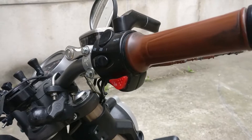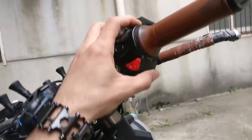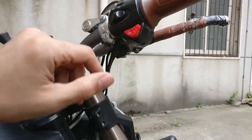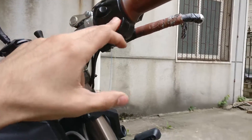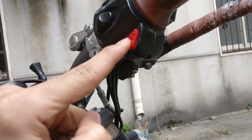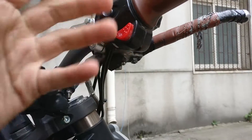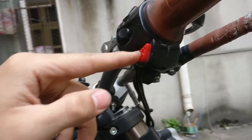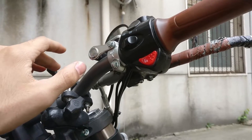I'm going to teach you two ways to fix it. One is temporary and one is to cancel it completely. Let's say you are somewhere outside home and you're watching this video and you just want to get back home without having to press the button all the time and using the throttle. It's pretty easy — just use any tape or zip ties and keep it pressured. It should get you home because it only works when the wires are connected; that's when the throttle actually gives power. It's better if you make it pushed inwards and upwards — that's where the wires are and that's just better.